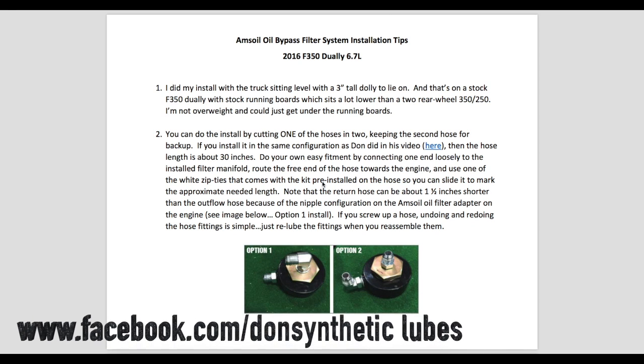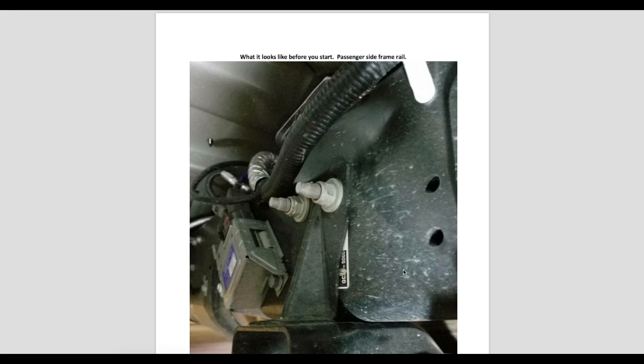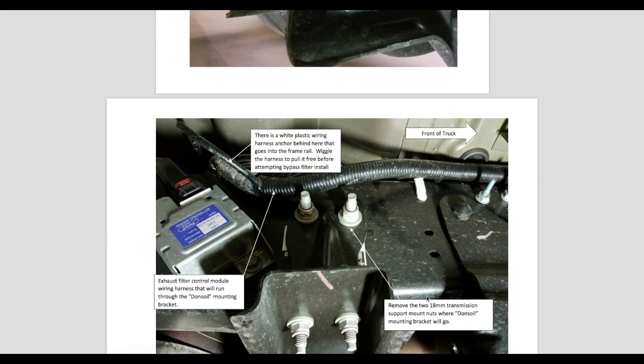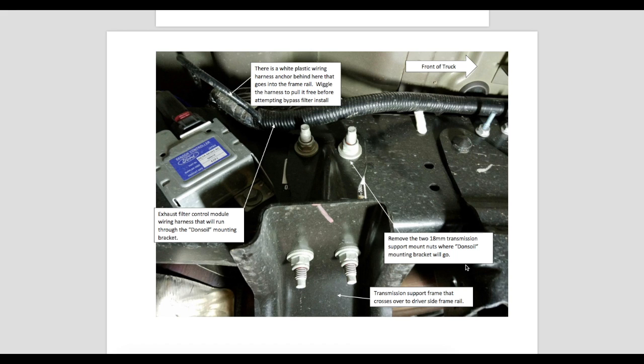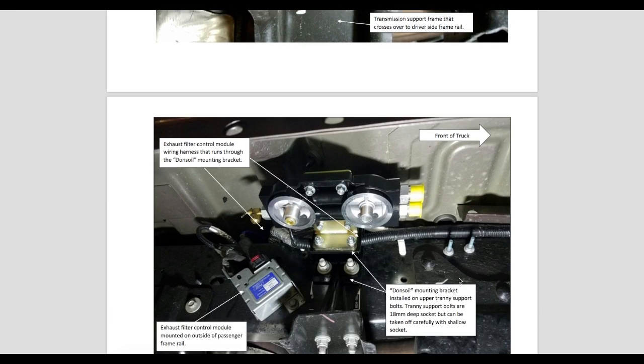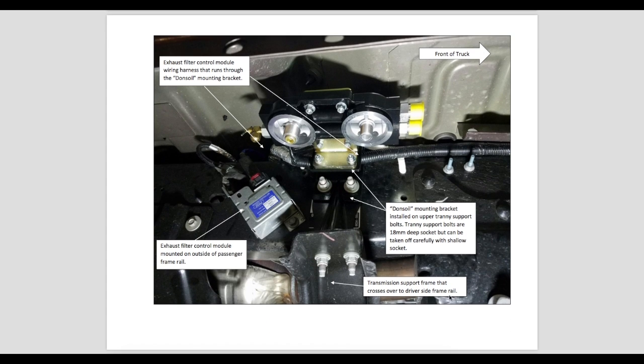I'll have this on my Facebook page as well. Here are the starting pictures. This is a shot of the side of the frame rail underneath the passenger side cab. The two bolts you see right there are 18-millimeter nuts on those studs or bolts that come through from the inside of the frame — that's where the bypass mount will go. The next picture gives you some idea of where the front of the truck is. The wiring harness is going to be routed through the bypass filter mount bracket. Here's a shot after he's got it all bolted up — you can see the transmission crossmember mount with his two bolts, the filter head up, and the wiring harness through.